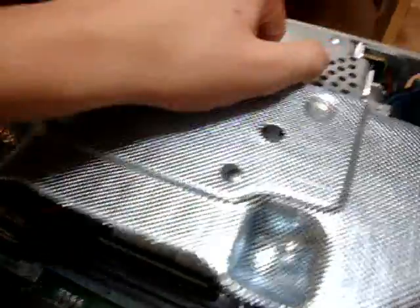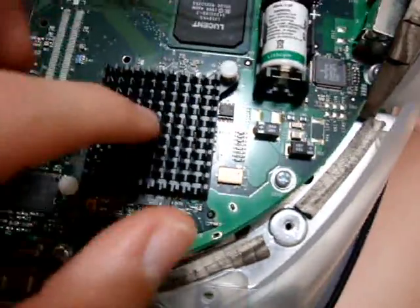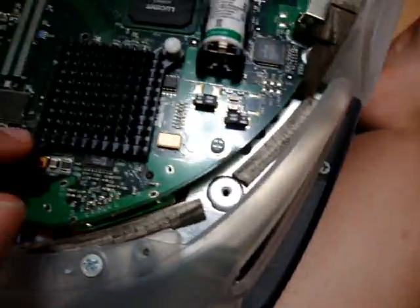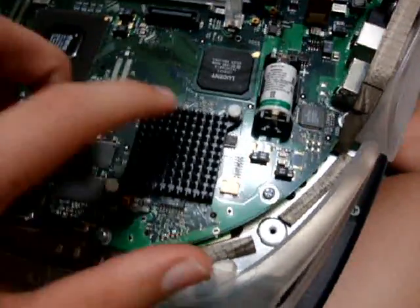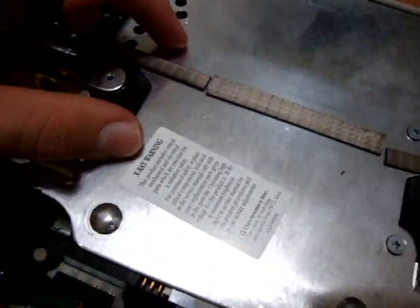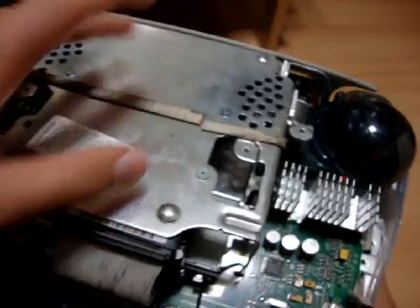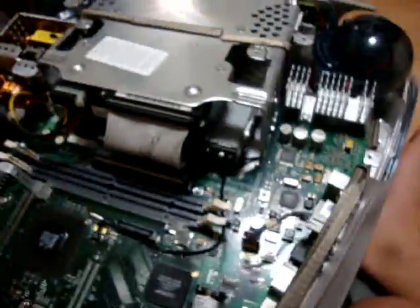Taking the radiation shield out is kind of tricky, because if you have the VGA port it's a bit annoying — you have to lift and jiggle a little to get it off the back. And voila — this is inside your iMac. You can do a processor upgrade — upgrade this to a 400 MHz G4 for about $400. This is currently a 400 MHz G3; I'm probably going to put in a 700 MHz. You can also double the video RAM. The next screws are these four up top, and the hard drive slides out.